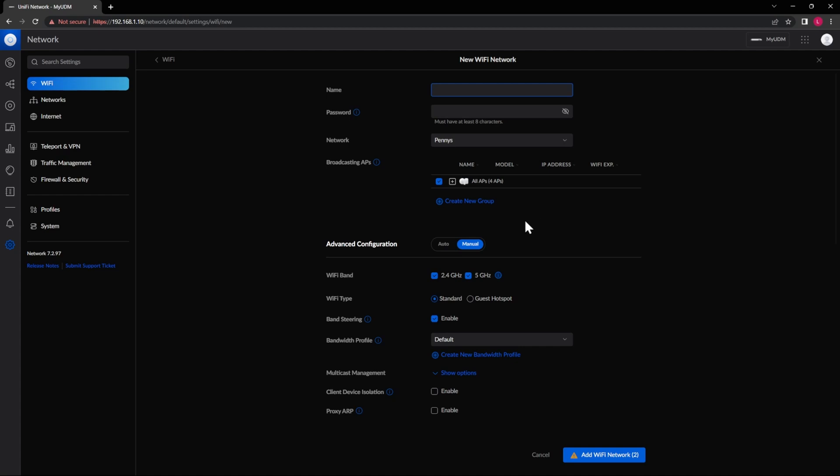To make it easy, give both bands the same SSID or network name. I use Ubiquiti networking but yours may be different. On the same page where you create the network name and password, make sure the 2.4 gigahertz band is selected — that's probably the biggest trick. From the screen on the Bambu, you select this network name and enter the same password, but do make sure you're on the 2.4GHz network, otherwise it'll cause issues connecting to Orca, Studio, and the Handy app on your phone.